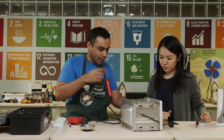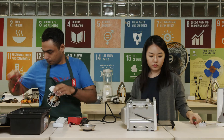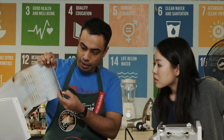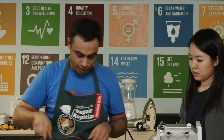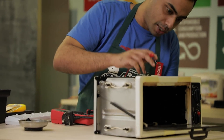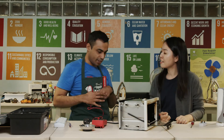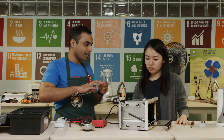Let's do a quick check on the heating element. We run through the same numbers on the label — 220 to 240 volts, 1090 watts. There are a couple of heating elements, so we shall do a thorough check. All our heating elements are clearly within their working resistance, so the heating elements are fine.